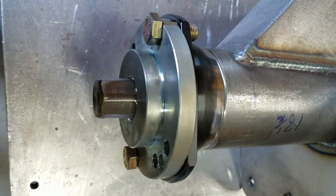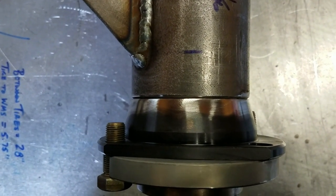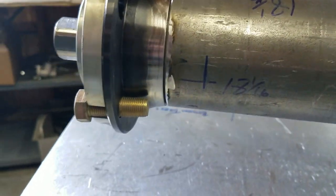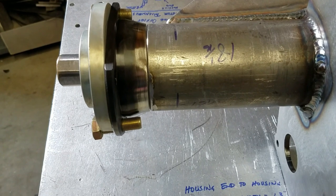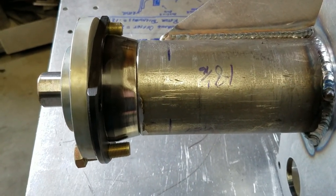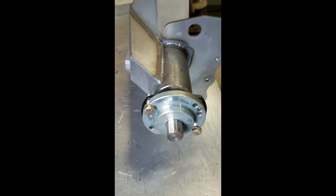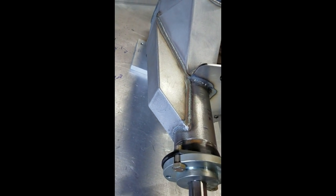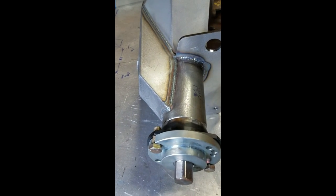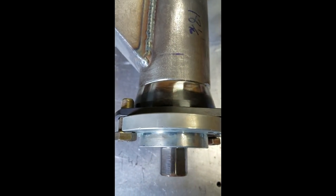Here we are putting the actual housing ends on the tubes once it's all been cut to length. The alignment is pretty darn good — that's the difficult part to keep while welding the back brace and everything on. The tubes always want to pull towards the heat, so I'll share a picture showing a big bar running across the face of the third member with large clamps holding onto the tubes to keep them from pulling. Another trick I prefer: I like to actually MIG weld the back brace on when possible — MIG welding in my opinion pulls a lot less, and it's plenty of strength for what the back brace's purpose is, and it helps with this end result of the housing end being aligned pretty darn nice.